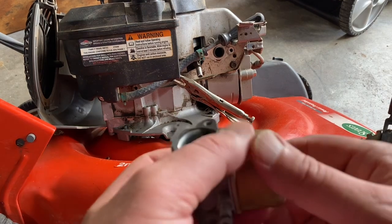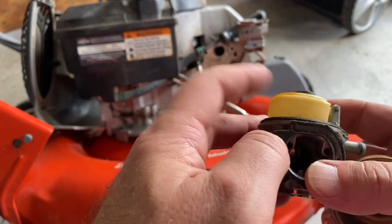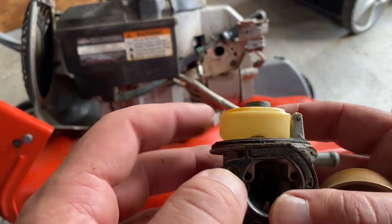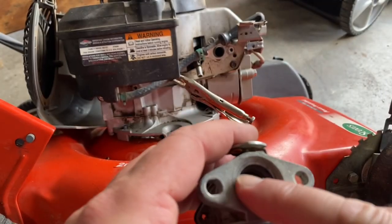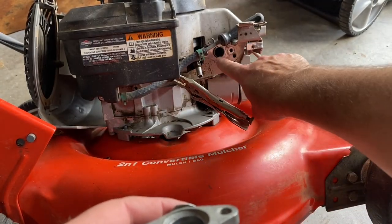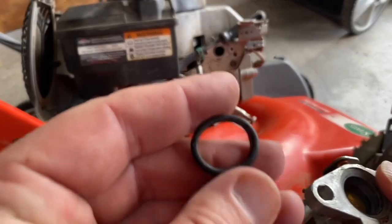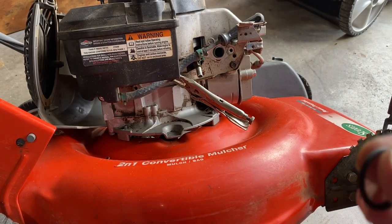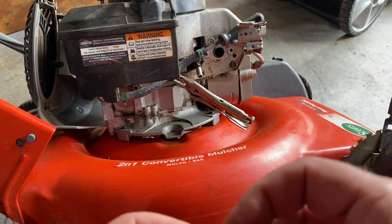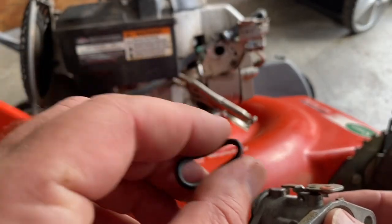So now where we were, here in the carburetor, you see it's pushed up a little bit. The carburetor doesn't smell good either. Also, this O-ring that goes here, usually it'll sometimes stick to the block. I'm gonna go ahead and replace that. This has gotten a little bit, it's not as pliable as it used to be. It's been squished, so I got another one that I had from something in the past.